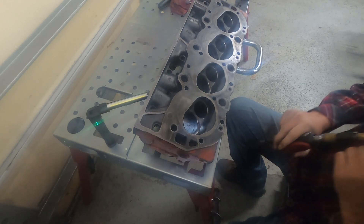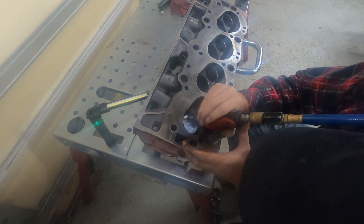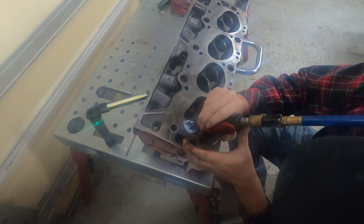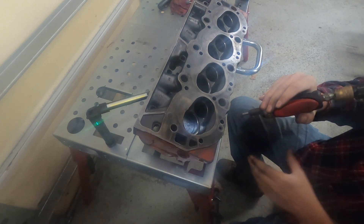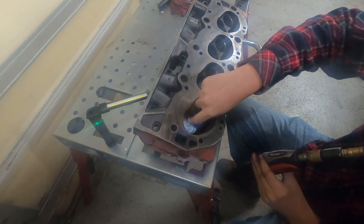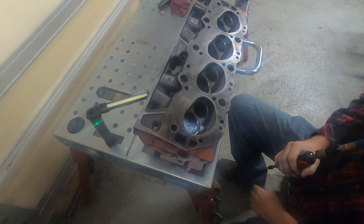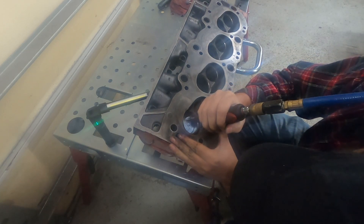When I'm porting stuff like this, I'll just have the hose over my shoulder and I kind of get everything in here, mock up my movements so I can be sure I'm going to be able to work on the parts I want without getting too out of control. I definitely don't want this thing jumping around, getting into my seats — that's why I want to have a lot of good control, only take out metal where I want to take it out. I'm going to start just right here along this right edge and see how this is taking out metal.